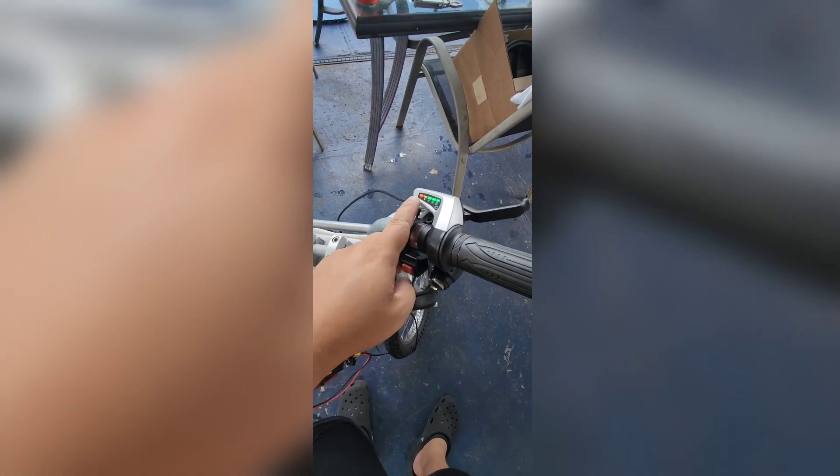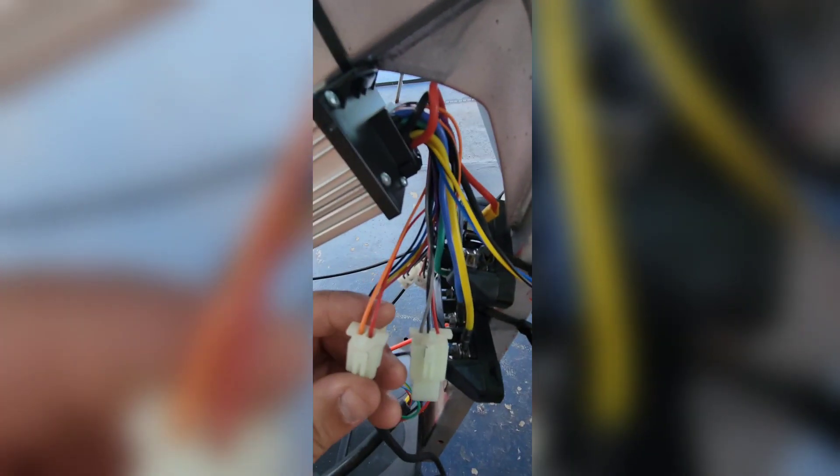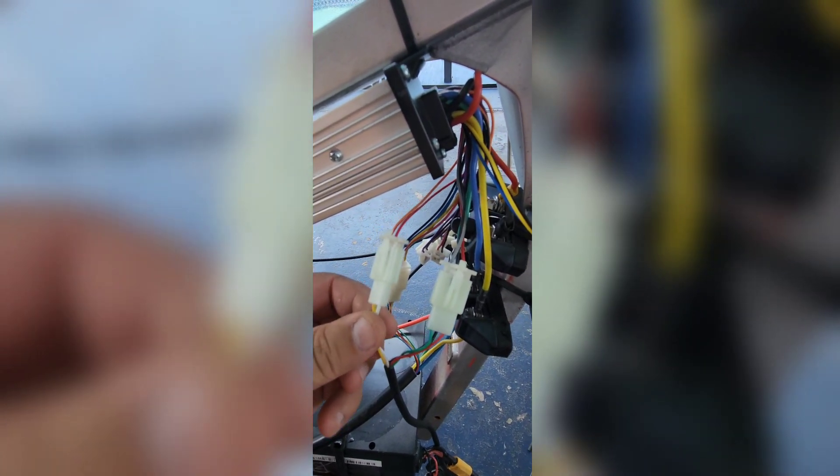Quick tip: if you guys have a Vivor 2000-watt kit and when you switch the key off it stays on, here's a very quick and simple fix. Make sure you power this off and disconnect your battery. Then go to your key lock switch — it's red and orange on the harness side. The yellow and white wires: get some tweezers, pinch the little leads on the inside, it has a little clip — swap those two wires around, take the little tab, push it back out, and click it all back together. Now the power switches on and off like it should — the bike doesn't run with the power off. Put the power on and it moves. Quick fix.